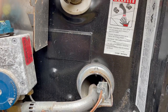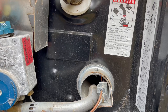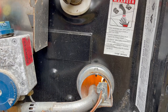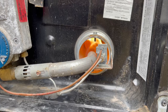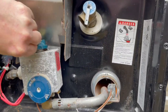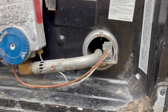After holding the button for a moment, we'll go to on and see what kind of flame we get. See how that's a really yellow, lazy flame — that's going to start being sooty. That's not what you want. You want a blue roaring flame. So there's something in here plugging this up. We're going to turn it back off — see the soot coming out. So we'll turn that back off, let it cool down, and get the tools out and get ready to open this up so we can blast through it with some air.